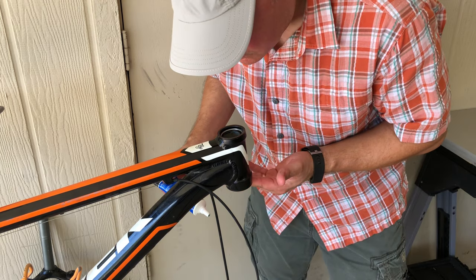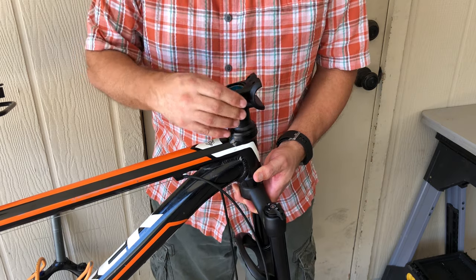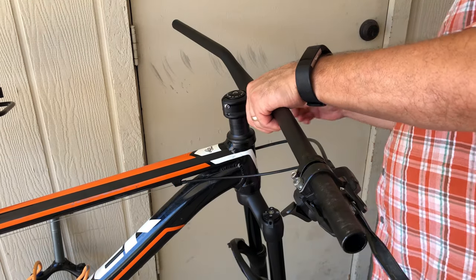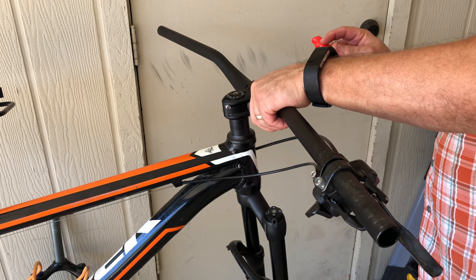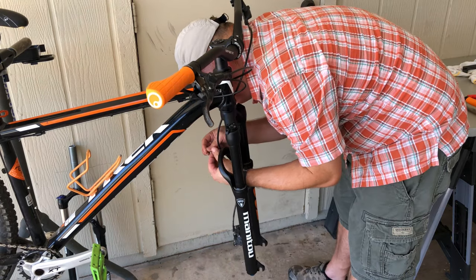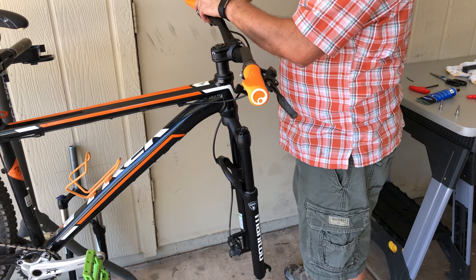Now that the fork is ready, let's install it. Make sure the frame is wiped clean and add the bearings with some fresh grease. Slide in the fork, add the base and spacers, then add the stem. Go ahead and install the stem cap. Make sure you don't tighten down everything so you can adjust the direction with the handlebar. The final steps for the upgrade will be to install the handlebar and new grips. Align the bar and install the face plate for the stem. Add the grip, then tighten down the shifter and the brake lever. Next, install the front brake and attach the hydraulic hose to the fork using zip ties. Manitou uses a reverse arch on their forks so the hose is out of the way. Add the last grip and tighten down the front brake lever and we're done.